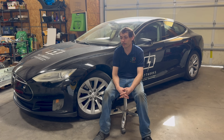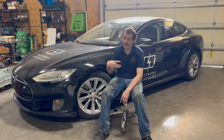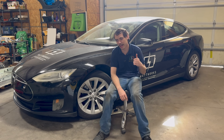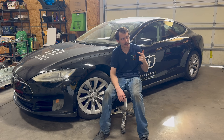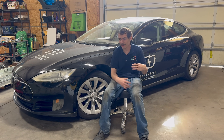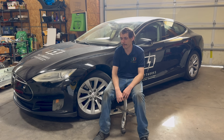Sometimes you can end up with a situation where you have a brick with a weak short, and that's not really as repairable. Swapping modules really isn't a viable repair method for these packs. Even if you have a huge pool of modules to pull from, it's still a massive undertaking to match modules to the packs — you need voltage balance, pretty much the exact same capacity, internal resistance, ideally the same number of cycles and calendar life aging. Finding a perfect module is like finding a needle in a haystack, and module swaps rarely hold up long-term. In most cases that might last a few months to a year, sometimes two or three years. Generally speaking, module swaps just aren't a super viable long-term repair.